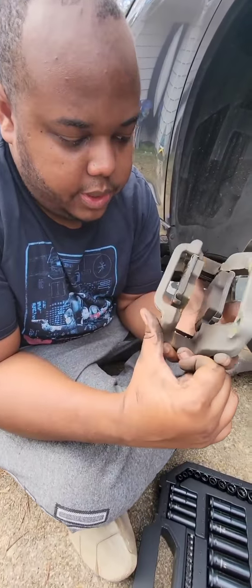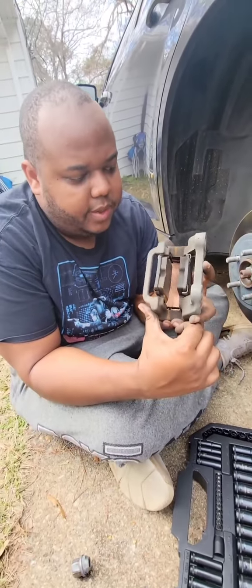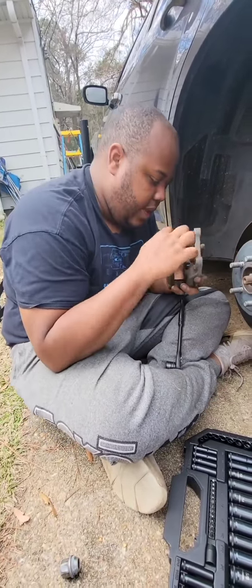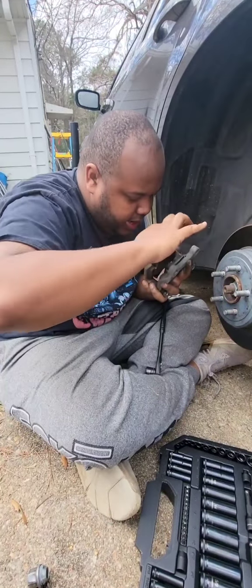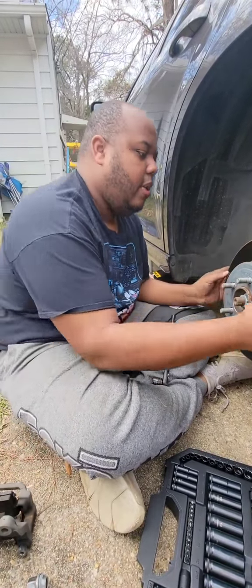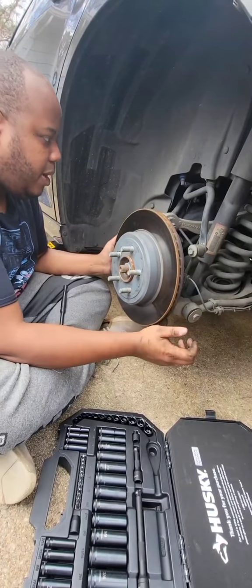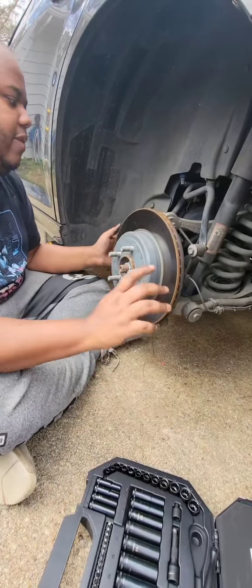We got some new ones and we got some grease. I'm gonna get the grease and I'm gonna get the spray — spray everything down and just change these out. When I tell you they squeak bad... I feel like I could get by with these, but I got some really good pads and I should go ahead and change them while I got them off. We're gonna get rid of this hardware because if it's smooth it'll squeak extremely loud. You can spray brake cleaner on it and it might get you by for a while, but while everything's off, let's check everything.